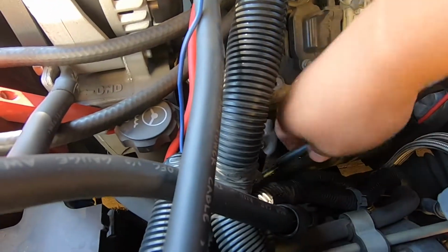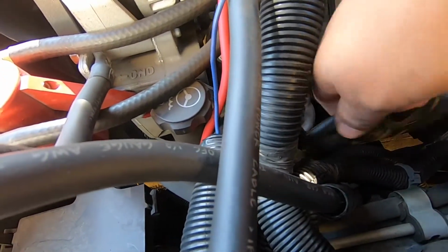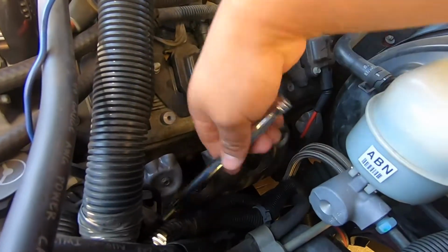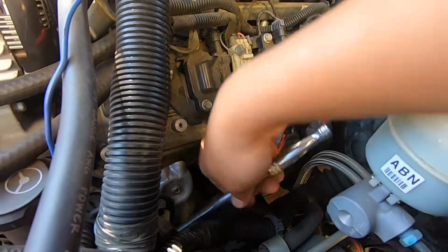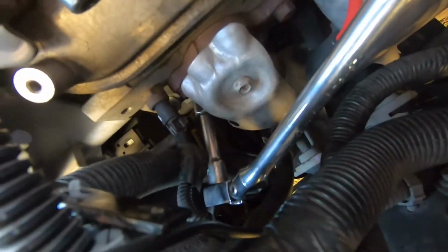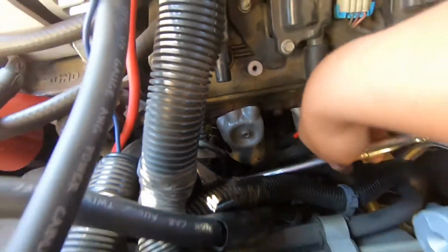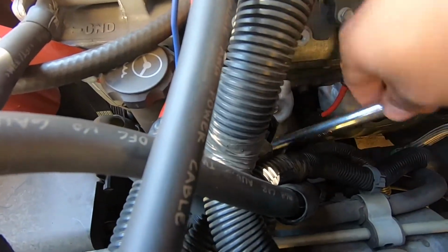Alright, so we're finishing up the last spark plug up here in the front. That one's one of the tightest ones on the driver's side. All the other ones, we finished them and we put the wires on. We're using one of the ratchets with the swivel head because everything is super tight in here. Well, not that tight, but it's just an awkward way to get to the spark plug because of these wires, the wiring harness that's in the way.